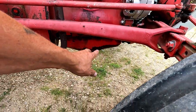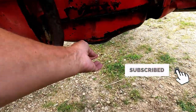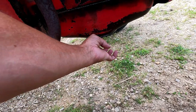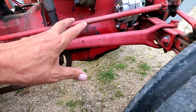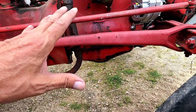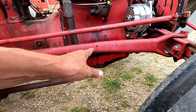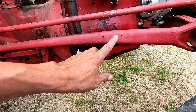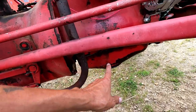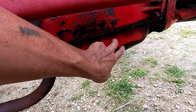I'm going to need a new oil pan — this one's dented. It took me forever to get this cover plate on there so that it doesn't leak, and it feels like it's still leaking. Hopefully I can find an original one at a junkyard because the aftermarket ones are really bad. I believe this is an aftermarket one itself — the original ones are cast iron and wouldn't dent, they would break. This is just sheet metal.